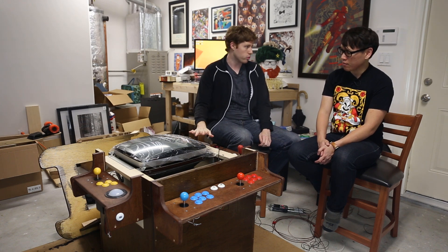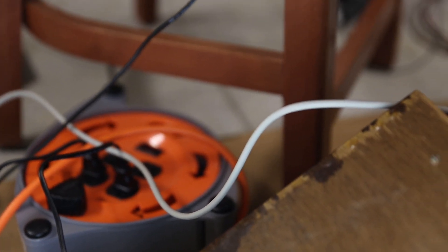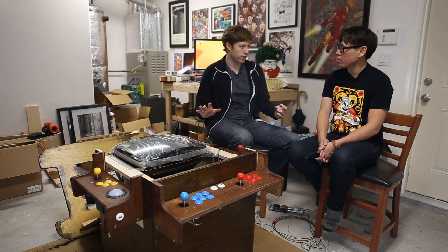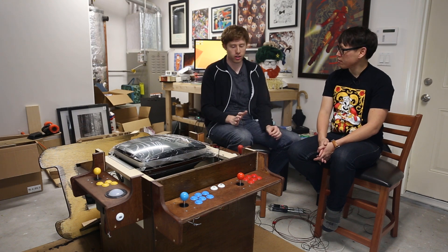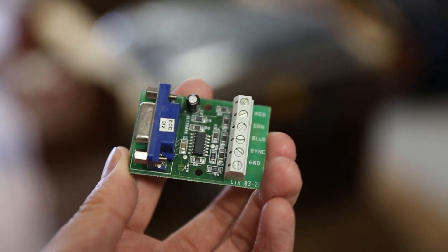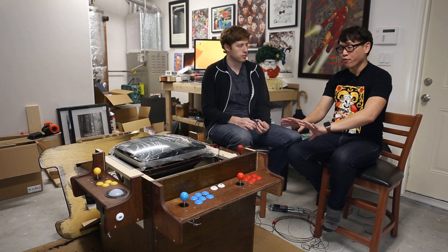Plugging this into the VGA card isn't like a normal HDTV or computer monitor — there's no VGA port on the CRT either. We got a special cable from Ultimark and a VGA signal booster, which we didn't actually have to use. Some CRT monitors require amplification, and there's not just one connector that everything uses — very different requirements for different monitors. If you can get a Wells Gardner, that's the most standard and you'll have no problem hooking it up to the ArcadeVGA. It can get tricky and you may have to splice your own cable. With VGA it's fairly simple — if you can buy a cable with the endpoints and leads, you can wire the RGB and other signals. Fortunately for us, we didn't have to do that. The cable that came with the video card plugged right in, along with the power going into the monitor.